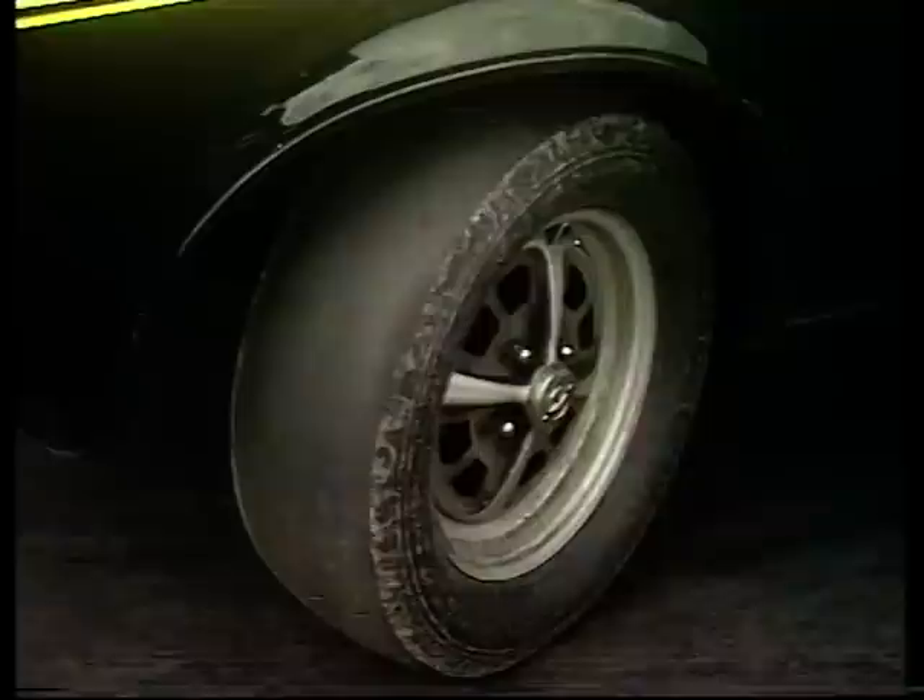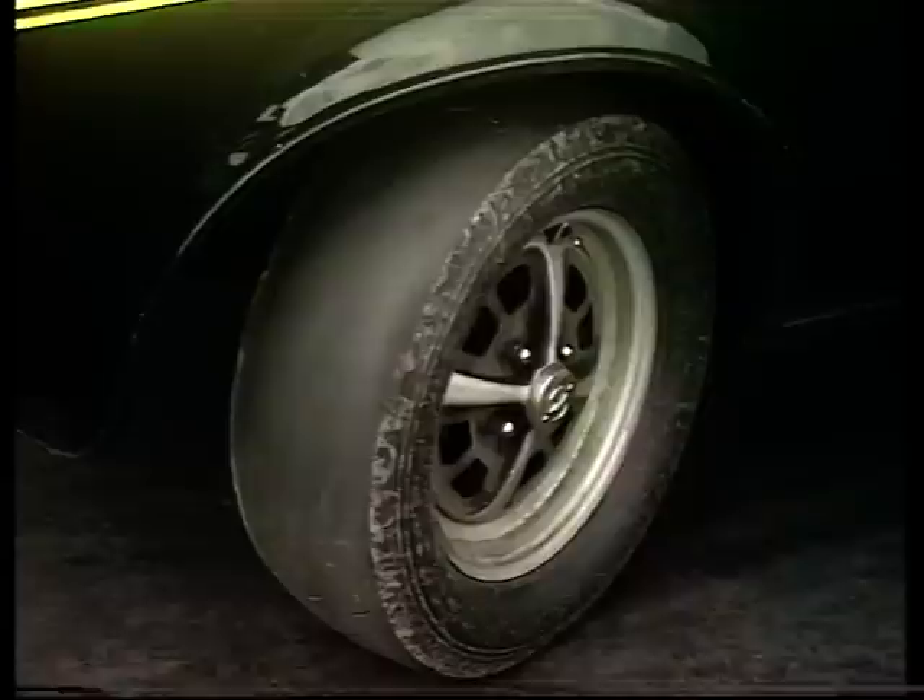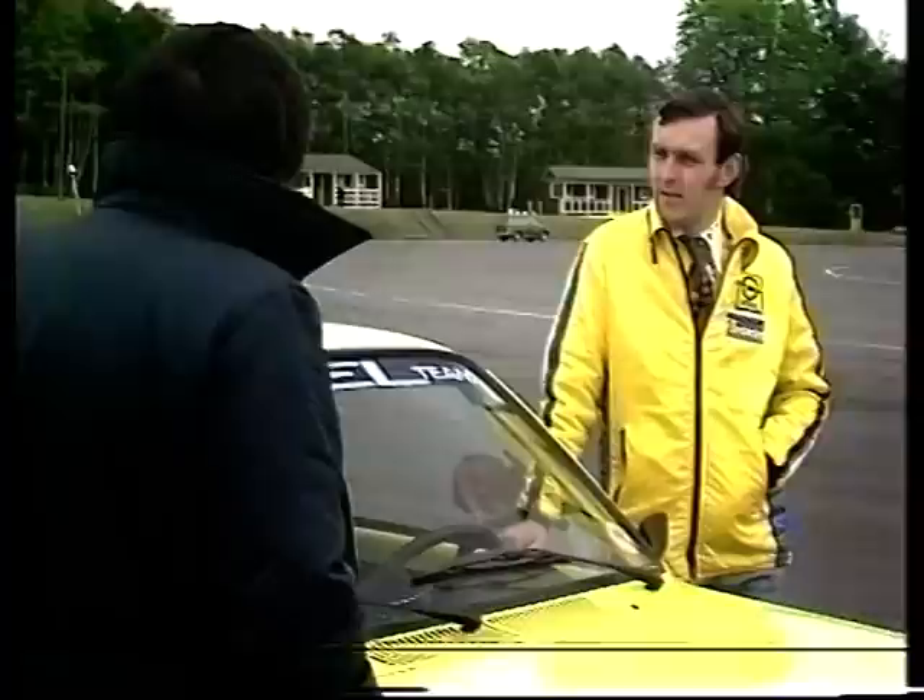Tony Ford, presumably that's exactly the sort of thing you'd like to avoid in the middle of a rally. Yes, that's right. Hopefully we wouldn't get the two combinations together. We would be very careful to avoid running with these tires when the conditions were either wet or slippery. When would you use these tires? When we were pretty sure that the roads were going to remain dry, no water about, no standing water and no mud or gravel on the surface.